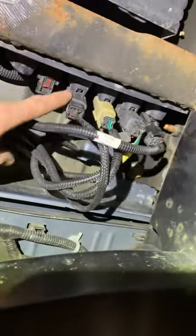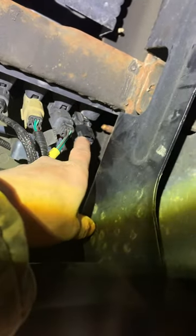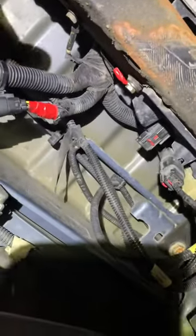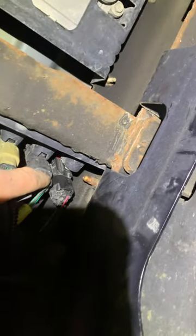On the left side, the driver's side, you're going to go under and come up to this control box, go all the way over to the right, the far right. There's a purple wire that you want to splice into, and that will be your power, and then your ground you can put wherever you want. I'll put mine right here, and it works. It's the far right side, spliced into the purple wire.